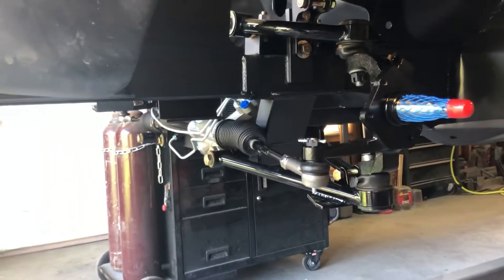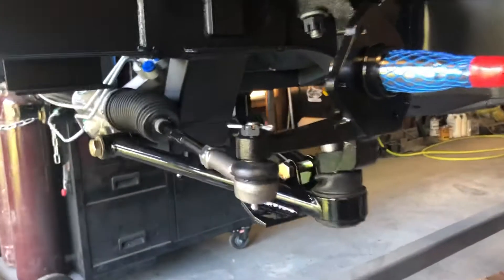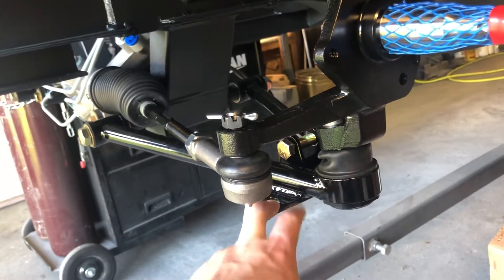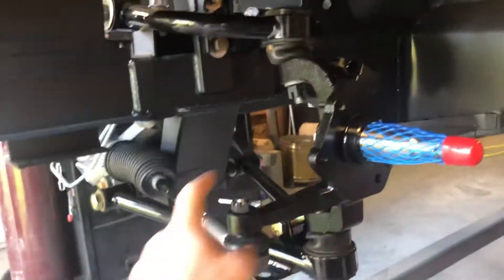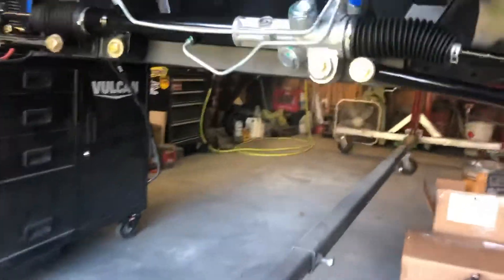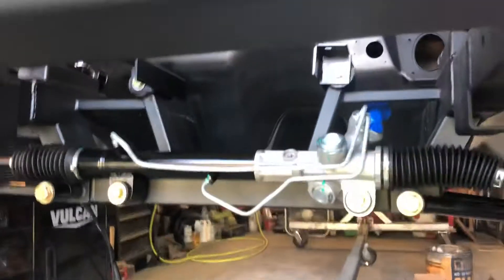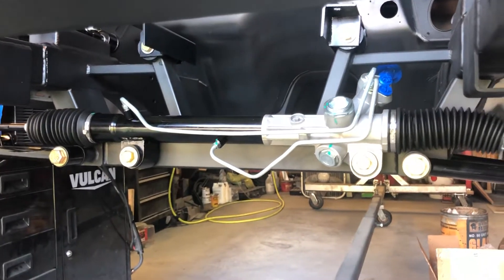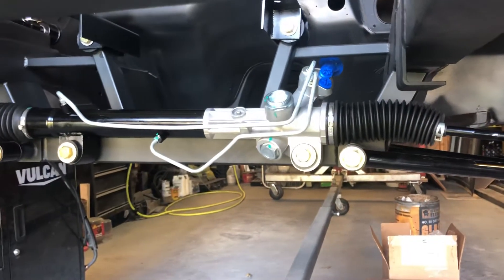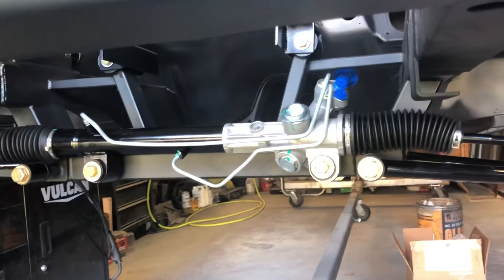I ordered the Super Lights — 14-inch front and back. Fronts are six-piston, rears are four-piston, slotted with black powder coat. These are Rod and Customs tubular powder-coated control arms. The spindle is theirs but not their rack — this rack is from Speedway. They list it as a Mustang 2 converted or Thunderbird rack. It bolts up perfect and is a hundred dollars less than what Rod and Customs wanted.